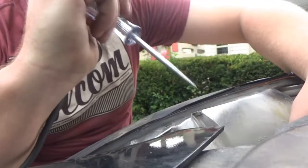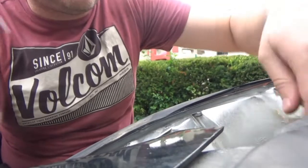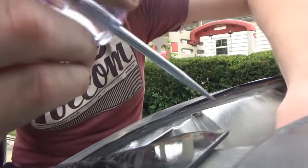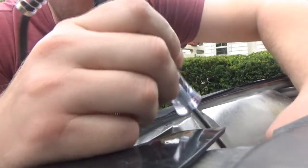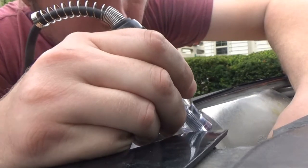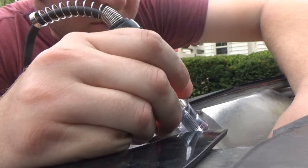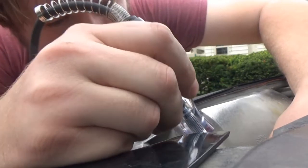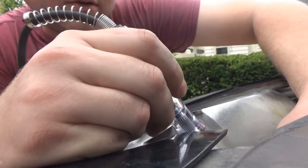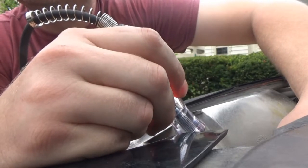All right, so I got her in the car. We have our test light hooked up to battery negative. So when we probe, I'm not sure what you guys can see. When we probe, oh, I dropped it. Hold on. When we probe the green wire, which is from the control side, this test light should light. Hold on a second. Oh wait, that's full-time power. Interesting. So we don't have anything here. Let me reverse the test light real quick. Because this is getting power. Hold on a second.